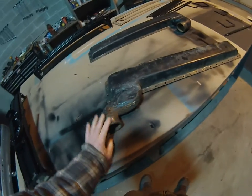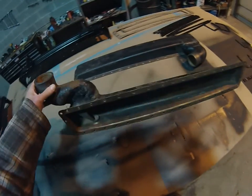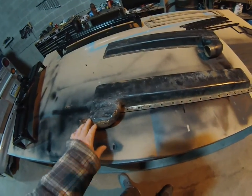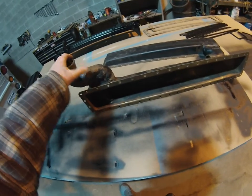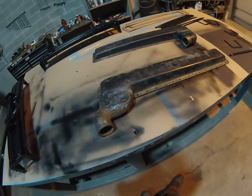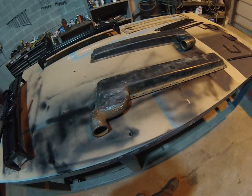The outside neck where the hose clamp goes is in pretty good shape. And when I stick my hand in here, I don't feel any kind of a crack or anything growing. So this had just a tiny weep hole. I don't even know where it is, somewhere around here. That was the only leak in the whole system. So what I did was I went over this with a needle descaler carefully, just to get off any loose material. And then I'm going to give it another thin coat of JB Weld or some kind of radiator sealer compound just to keep it from leaking. The system only works at, I believe, 5 psi. So it's really not under a tremendous amount of pressure.